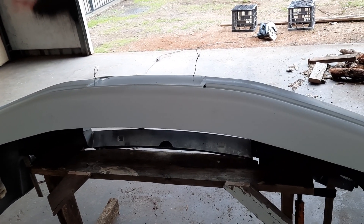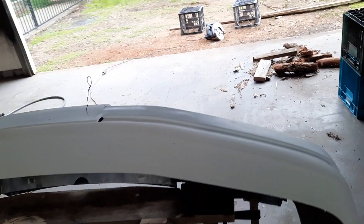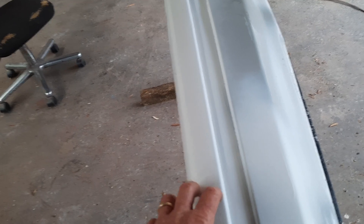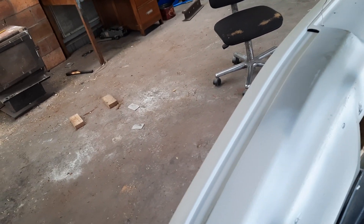I've got to rub this as it's a heavy first coat. I rubbed that with wet 240, but first I scuffed it with 80 grade to make it pretty coarse, then went over it with a plastic adhesion primer and then the two-pack. The reason I used 80 is I want a mechanical bond — that should help it not peel off, helping it adhere to the plastic through all the deep scratches.